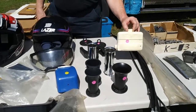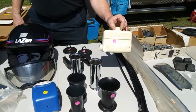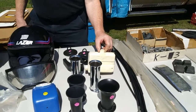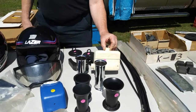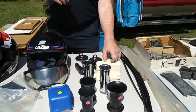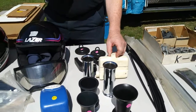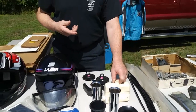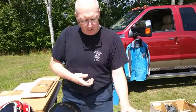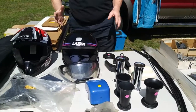This piece is for a '73 Thunderjet. It's what they call the sump tank. It mounted down low behind the engine. What it was used for is when the pump would draw off of this, the fuel would run down into this tank from the fuel tank. What it did was allow it to keep running on the oval track so that when you're turning the corner, the fuel pickup wouldn't come out of the fuel and starve the engine. This thing typically stayed full of fuel, so you would never lean out and burn the engine.